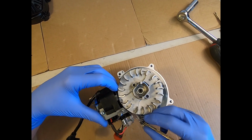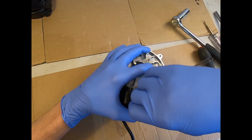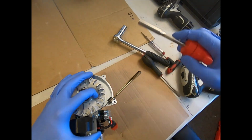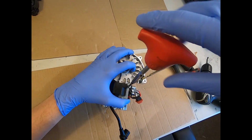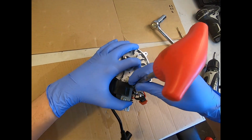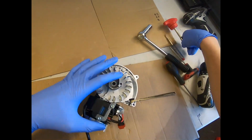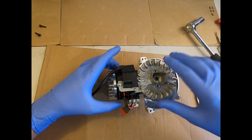I've tried it out of pure interest so that I could answer questions and make it easier for me to troubleshoot later. But you just get your air gap tool, whatever you're using, between the coil and the flywheel, and then I should turn my tool around. Nip these up. 4 Newton meters for these two, or by feel if you're experienced and confident. Being M4s, they would be quite easy to strip in the casting there, so just be careful.